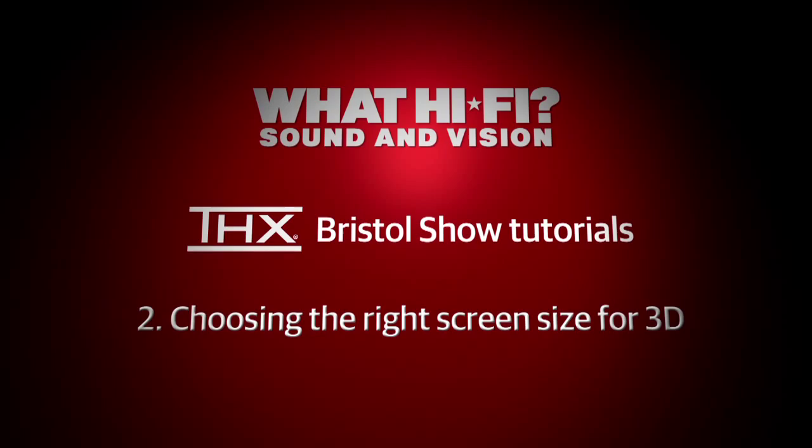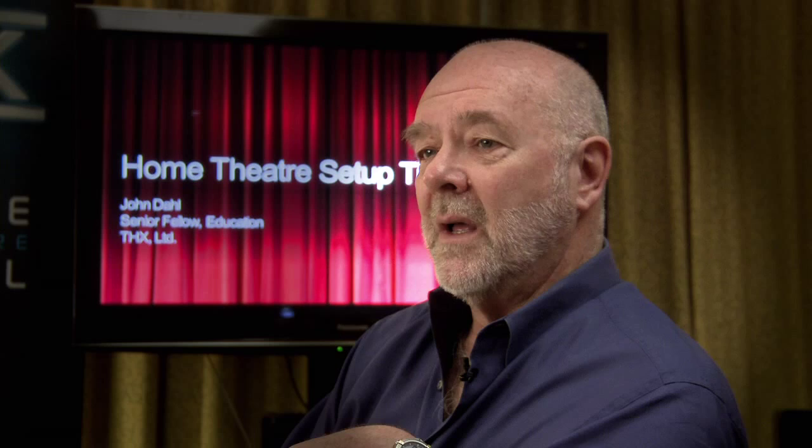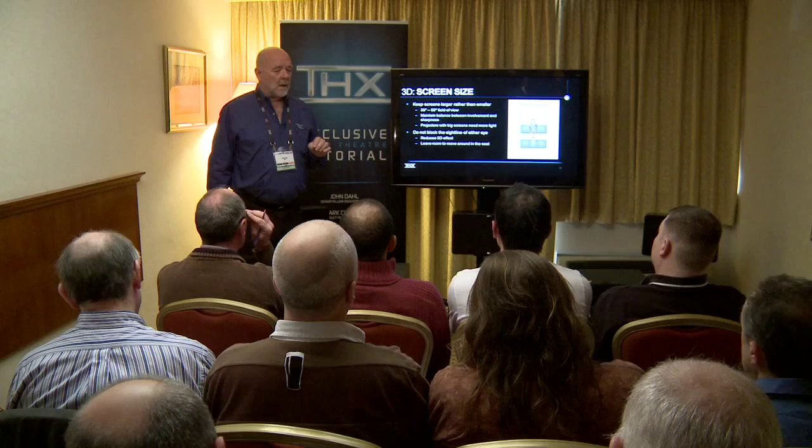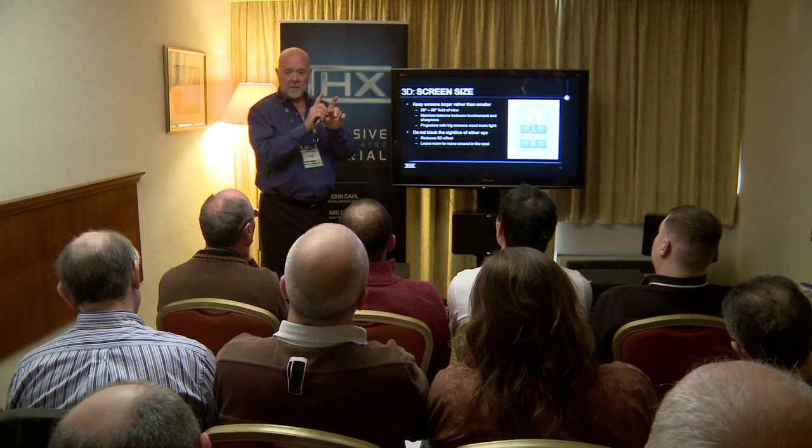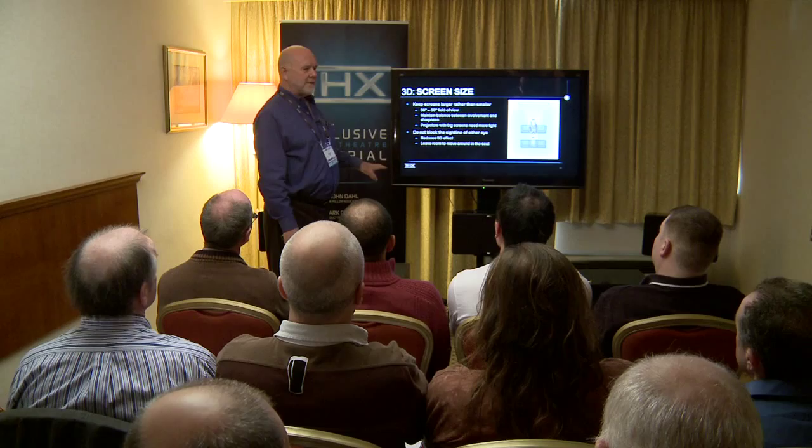As far as screen size, which is one of the first things people want to know, our general recommendation is make it bigger. Because when we interview people after they've had their screen for a month or so, they almost universally wish they'd bought a bigger one. If you're going to do a 16 by 9 screen, here's a number to get a 40-degree screen, which is kind of right in the middle and about as big as we recommend for a flat panel. Take the diagonal measurement — which worldwide is measured in inches, not centimeters — and use the multiplier 0.84.